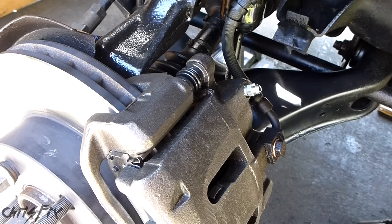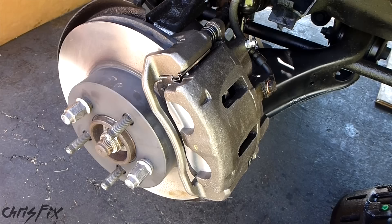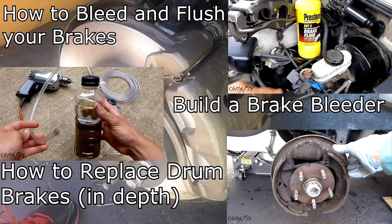Before you go on a test drive, make sure you pump your brakes to confirm there's no air in them. If they feel soft or go to the floor, you didn't bleed them right — just bleed them again until that brake pedal feels firm. Remember where your emergency brake is. Make sure there's nobody behind you or in front of you when testing. Don't go fast to start — make sure your car brakes, then check for leaks. Those are just some safety precautions I would take. Hopefully this video was helpful — if it was, give it a thumbs up and consider subscribing.